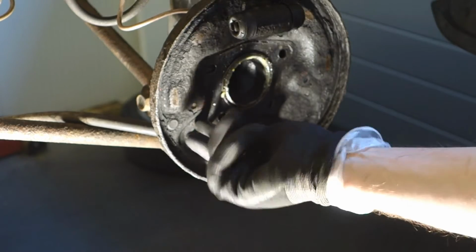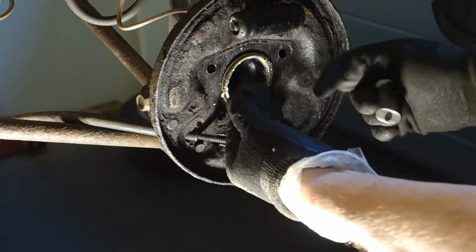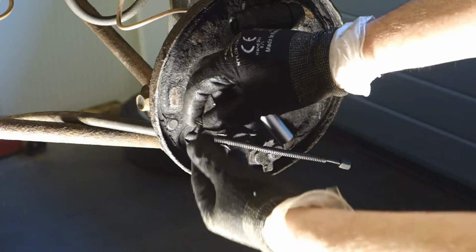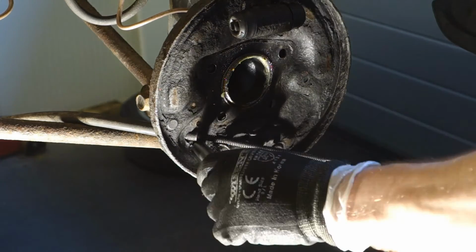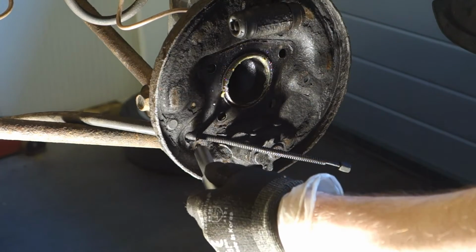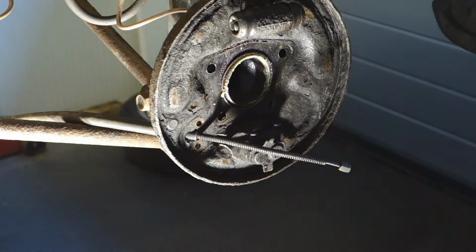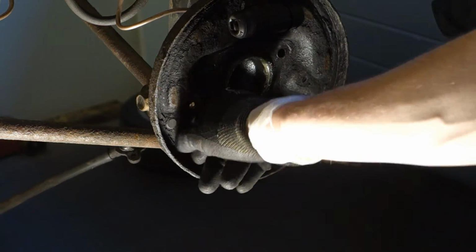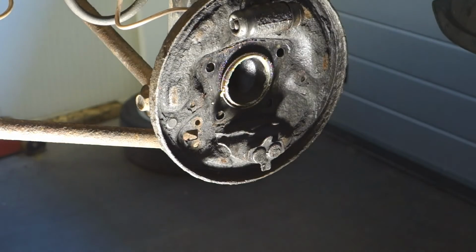out. Now I rotate. There is the first bolt. It looks like that. Small 10mm bolt, and then there's a similar 10mm. And now when I have taken those out, this brake cable is free. Now I can move that in here, and the brake cable is down. Okay, and now we have to take this brake cable out, and then we can start to install this new cable next, or then we can try to lubricate that old one, and then we continue.